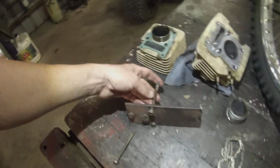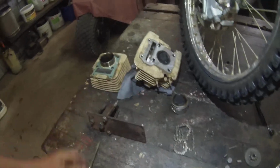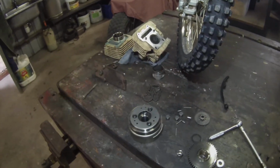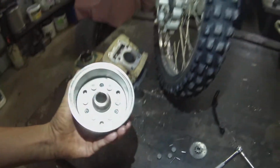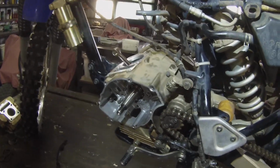The last puller I put on it, I didn't use high tensile bolts, and the bolts just snapped clean off. The plates were bending, and as I said, a $50 Toledo puller, stripped. So you can't beat quality. But anyway, anybody interested, that's the problem for the rattles of this motor. And it's the Yamaha TTR 125. Okay, thanks for watching.